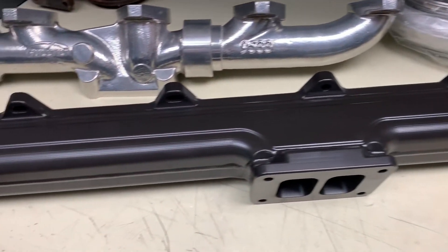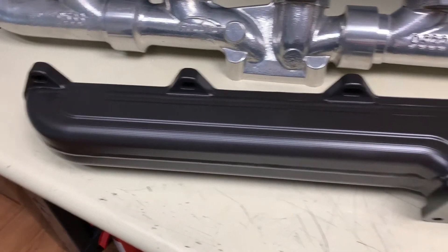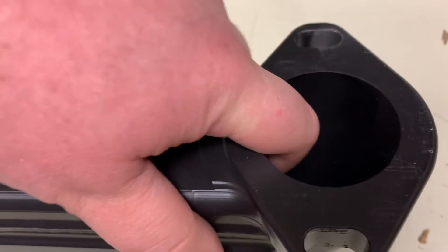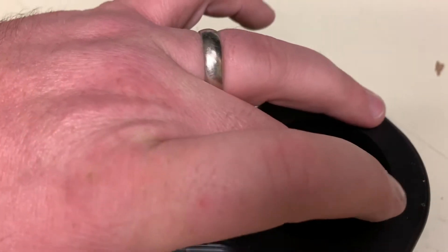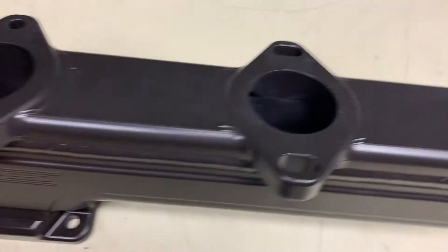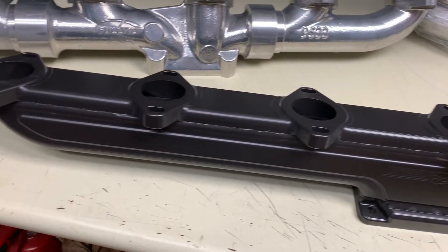Taking a look at the Steed Speed — it's a one-piece design versus the three-piece of the Full Tilt. Also a very smooth design. You can see the welds there in the back. One thing I did notice about this manifold is the curvature where it comes through going towards the center section where the turbo would be — it's a little bit skinnier as far as the flow. I don't have any flow characteristics here; this is literally just a physical examination of the two manifolds.